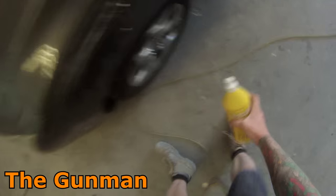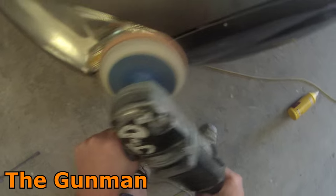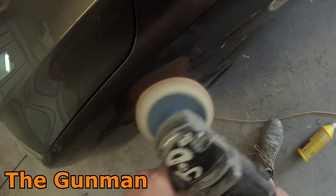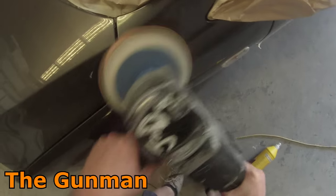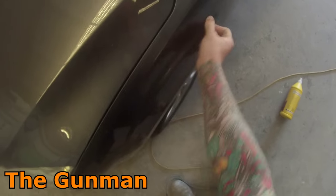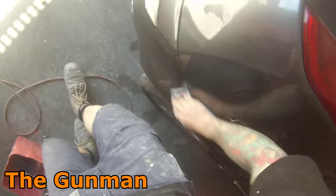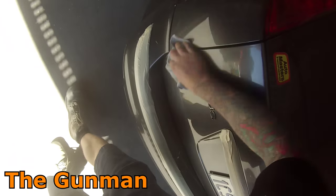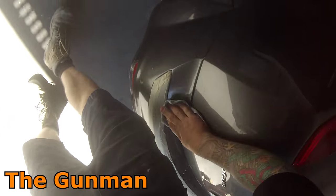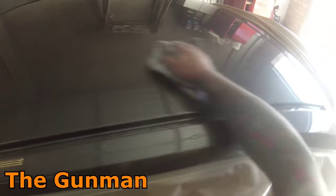When polishing the rest of the car, look at it and decide the condition of the paint. If you run your hand over it after cleaning and it's got overspray or mucky stuff on it, give it a clay bar first. They've got clay mitts or clay bars you can wash the car with - they remove grime before you polish and save a lot of time. You'll save on polishing pads, compound, and buff brushes. A clay bar costs around $20-30 and pays off in the end. Use it every four to six months depending on your parking situation.